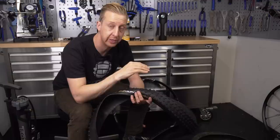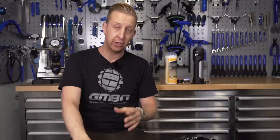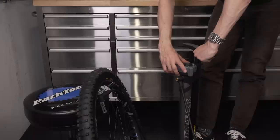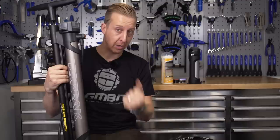For inflating the tire itself, you're gonna need some sort of pump. These days, setting up tubeless tires is mostly a lot easier than it used to be when you were using a conversion kit to turn a non-tubeless tire into a tubeless one — that could become really messy and a real pain. But these days you can get pumps that have a compressor-based chamber built onto them. You inflate this separately from the tire, then open a valve and let all of the air out in one hit, inflating the tire — much like using a compressor in a workshop.